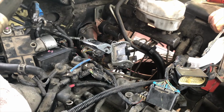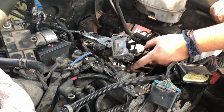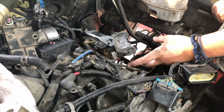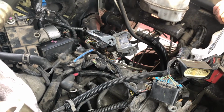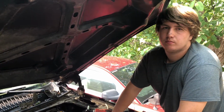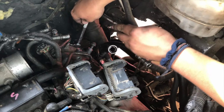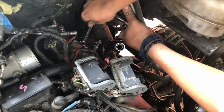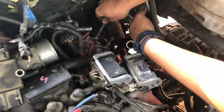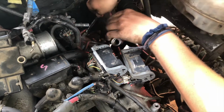So we're basically there to get to all the upper valve cover bolts. So we're gonna undo the injector lines and the upper valve cover bolts and get the upper valve cover off, and then we'll move on to the lower. This uses a lot of goop this time.